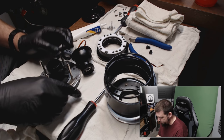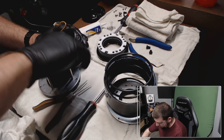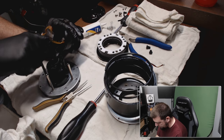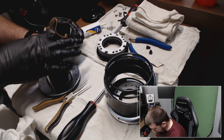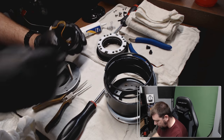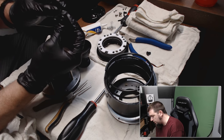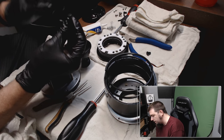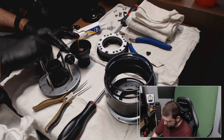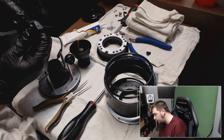On here, same thing — there's a seam all the way around the bottom here. You can kind of see it along the edge, it goes all the way around, so I sanded that down just a little bit. I used 400, 800, 1200 grit in that order. Then around the circular edges and on the other side. And I put sandpaper on a flat surface and just rotated around to sand off just a little bit of the outside.